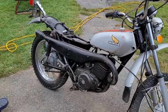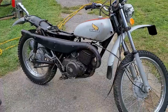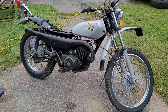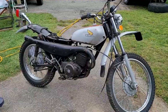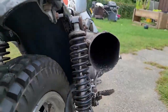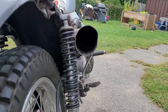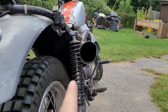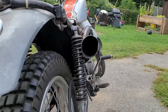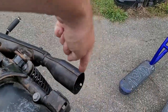So what do we got to do to this motor? The engine is burnt up. I'm going to show you guys some of the things you should be looking at when you're looking at a two-stroke bike — telltale signs you're going to have engine problems. First, we're gonna look at the exhaust baffle: it is missing and it's loaded with crap, and I believe it's cut. When that baffle is missing, that means it has a lean condition — a missing baffle is a direct cause of a lean condition.